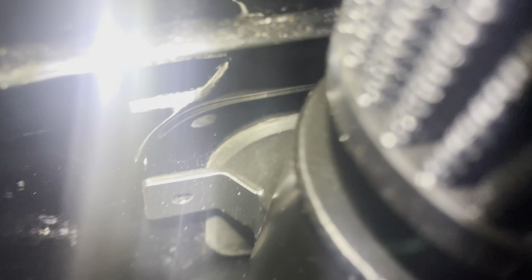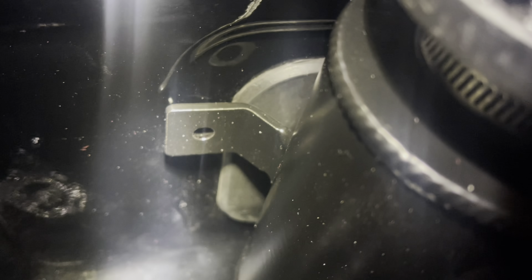Alright, update: Julio's finishing up the last line. We redid my oil drain line — it's back in right there. Another thing we did, we tapped the firewall and got one bolt on there to mount the catch can. We didn't do the other side yet because there's a gap there, so I need to figure out how I'm going to get a nut and bolt through. He's finishing the line up and then we can hook that up and the catch can is pretty much done.